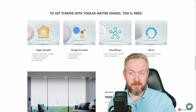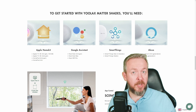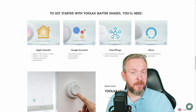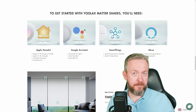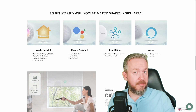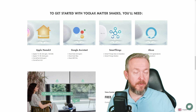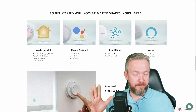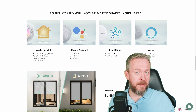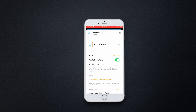If you have an Echo 4th generation, SmartThings Hub version 3, Nest Hub 2nd gen, or Apple's HomePod 2nd generation, you are good to go. What does Matter bring over Wi-Fi or Zigbee? The biggest benefit, in my opinion, is that you can select whatever ecosystem you want to use, and devices can be paired with multiple ecosystems simultaneously. With a standard Wi-Fi device, you usually have only one app that can directly control it — to add another, you have to remove it from the first. Same goes for Zigbee. With Matter, that limitation is gone.